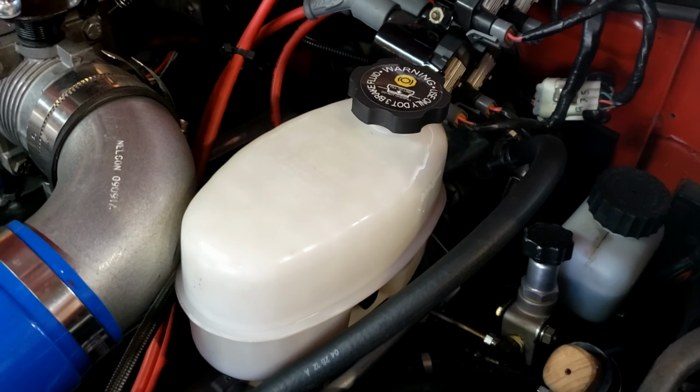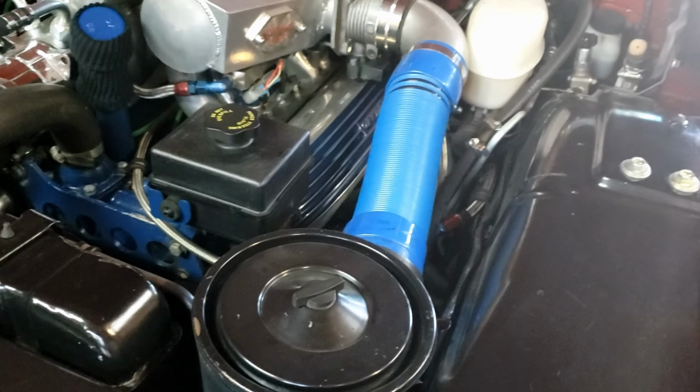And of course the power steering pump, the hydraulic fluid goes to the brake first, and then down to the power steering box. And from the power steering box, there's a return, as well as a return here. You can see they tee together right down here. One line's coming up from the bottom, that's from the power steering. This one's from the brake. They tee in and they go up through the cooler here, and from the cooler into the bottom of the reservoir. And that works good.